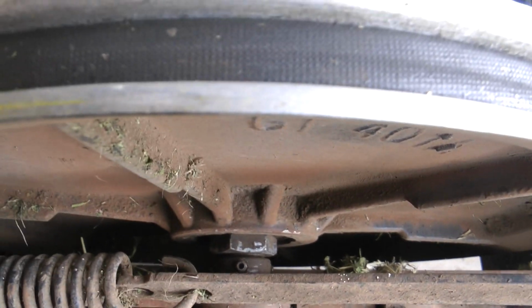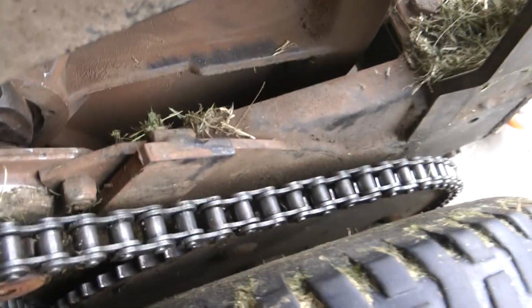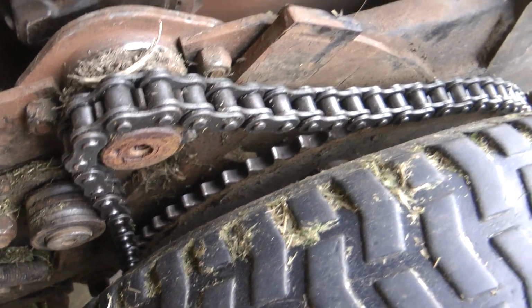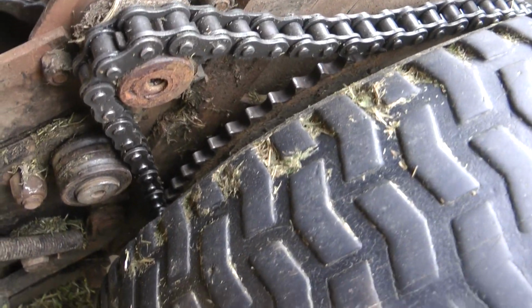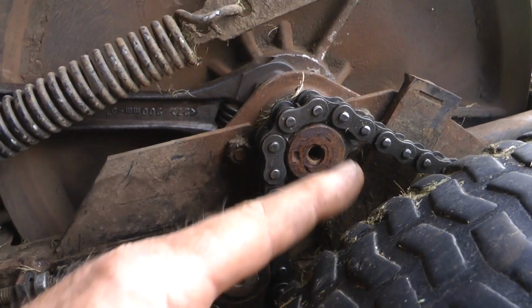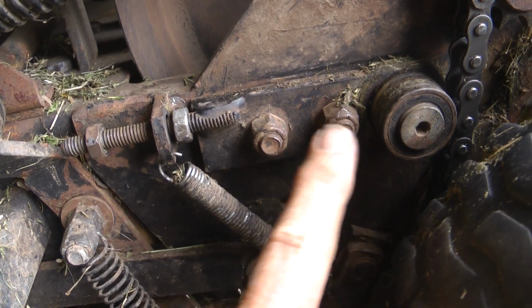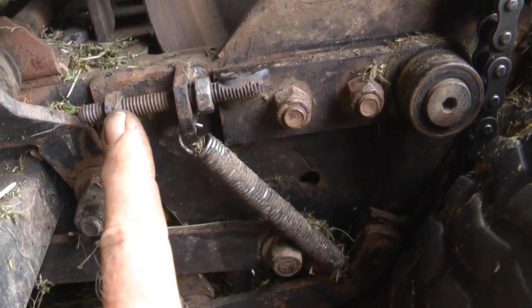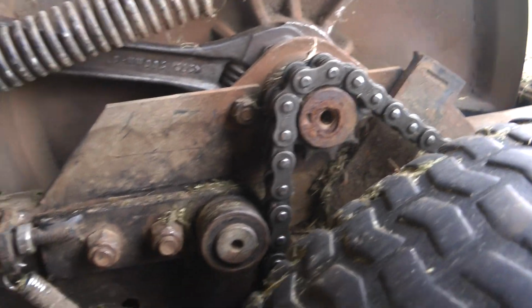Oh, let me get up there. You just got to hold that one there with the shifter. Put your shifter down there and hold it. Right, so then you can get that one off, because it'll just keep turning, obviously. So the tools you need really to do this is a shifter. You need a 13mm for here, and 14 for these, both of these and these locking nuts. The lock nuts and the adjustment nuts are all 14, but this one has 13 just to be different. So that's what you need.